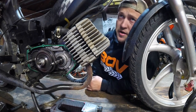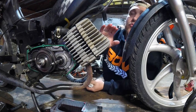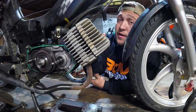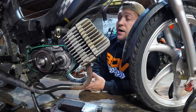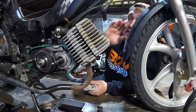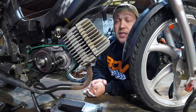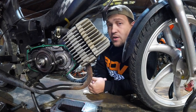Truth time, adventurers. One thing we are not going to address — we did the compression test and we're at 120 pounds, so there's really no reason for me to flip the head right-side up. It's not hurting anything. What we don't want to do is pull it off, because whatever gasket they're using in there, you'd likely have to replace it — you don't want to reuse the head gasket. So we're going with the motto: if it ain't broke, don't fix it. And if it's just a little broke, ride it anyway.